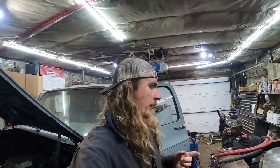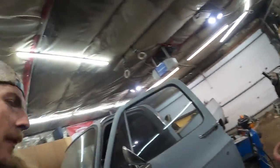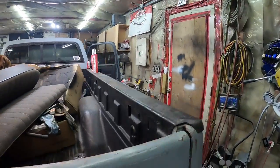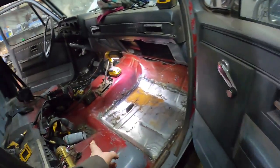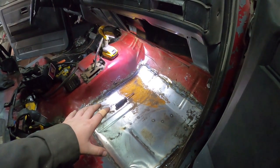What's going on guys, it's next day - it's actually late already, it's 9:30. I ended up working late, and then I came from the garage and started jamming. I wanted to get the floors done on the awkward side, because I didn't want to move the truck over - the battery's dead, has no seat in it, pick your excuse, I didn't do it. But I did get this side welded in, all solid, plug welded, it's all good, it just needs to be ground down.